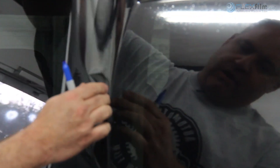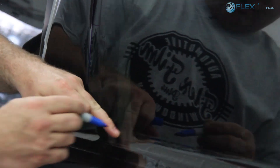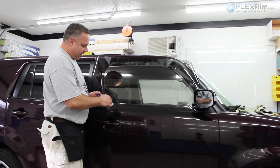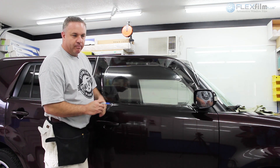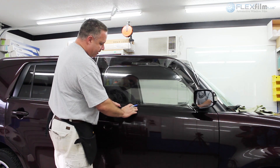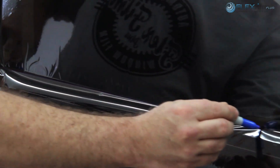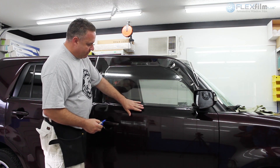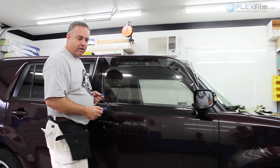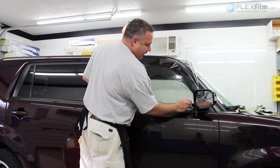I'm going to trace this before I even think about cutting it. I've shied away from cutting on cars — I actually like to mark my patterns and cut them at another location. I don't ever trust the factory straight edge. I don't even trust my own straight edge because if I depend on a machine to cut my straight edge and there's a problem, then I've got a problem. If I want to be responsible for my problems with bottom edges failing, I'm going to be the guy responsible. This is why I bring the film down and mark where I want my edge to be. It only takes me literally seconds to cut a new fresh edge with a sharp blade, and that prevents all the problems that come from trusting a factory edge. I'm also going to mark the sides — I don't want to force this film as it bunches up in the corner because I could actually bring on a crease.